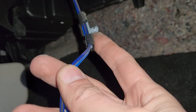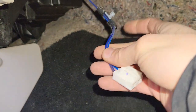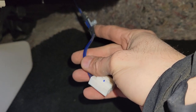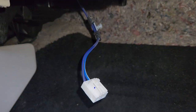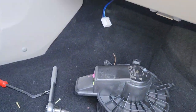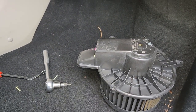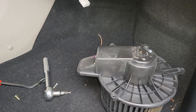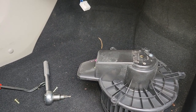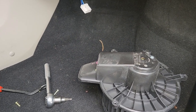There is also a plastic tab which was inside this hole right here, so you just have to pop it out — it's just a typical plastic trim screw. Once you install the new blower motor you can just pop it back in once you connect and install everything. That's pretty much everything. It's quite easy to do actually — it's a 10-15 minute job if you have all the right tools and if you are willing to put your body into a couple of awkward positions. Then it's easily doable.